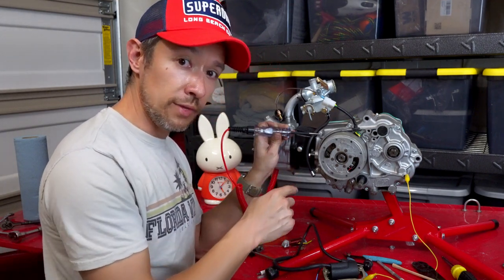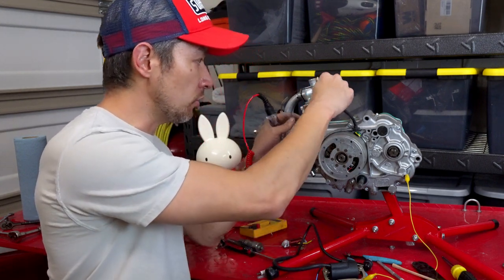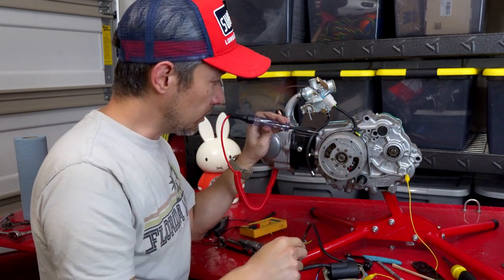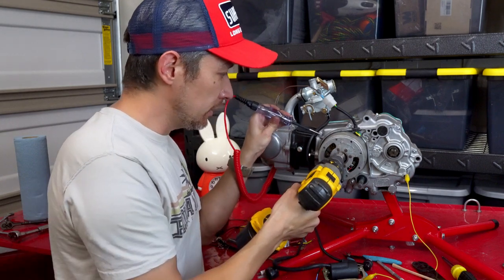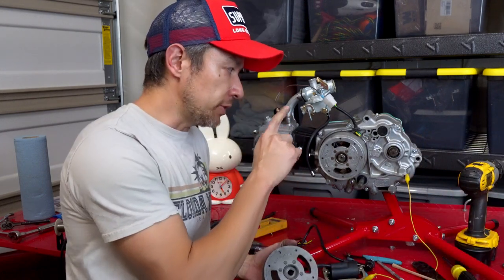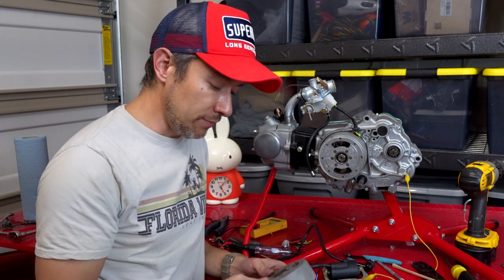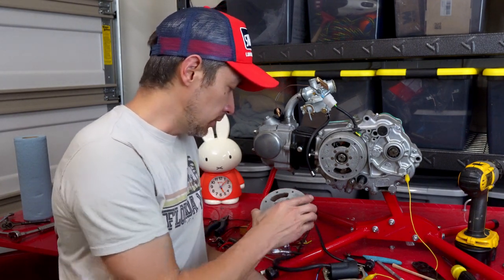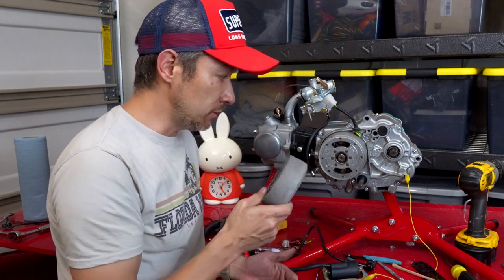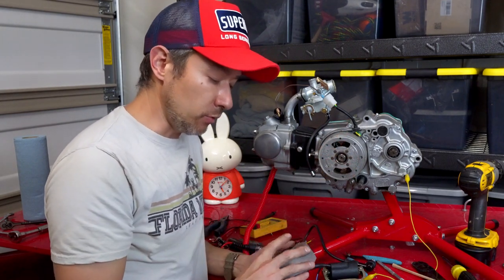I'm getting light, so that coil is working. In my initial test that coil was also working — it was the other coil that wasn't. To test that, just swap it over to the black line and ground it out. The fact that the yellow line was initially working and the black wasn't also indicated it probably wasn't the flywheel. I've heard flywheels can go bad — these are 40 years old — but in my case it's still very magnetic.